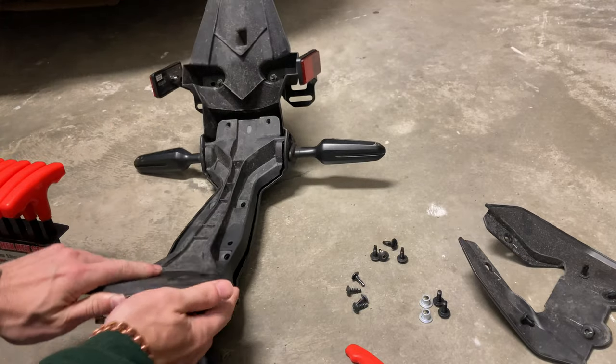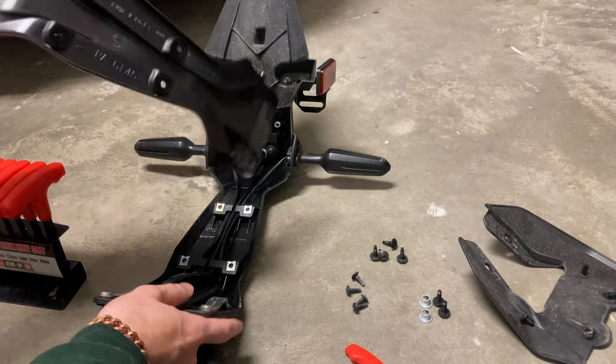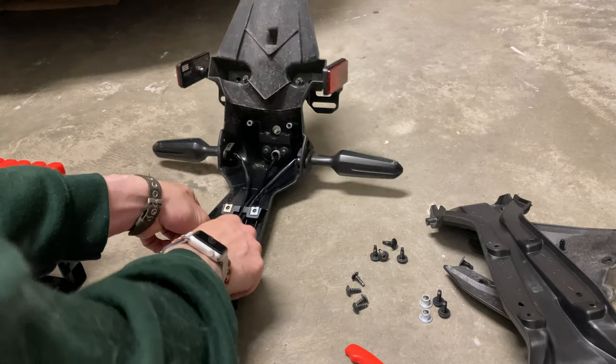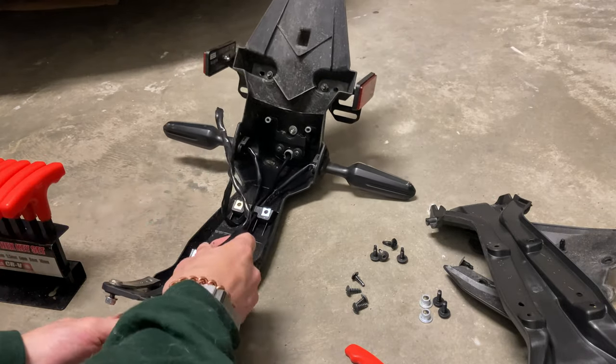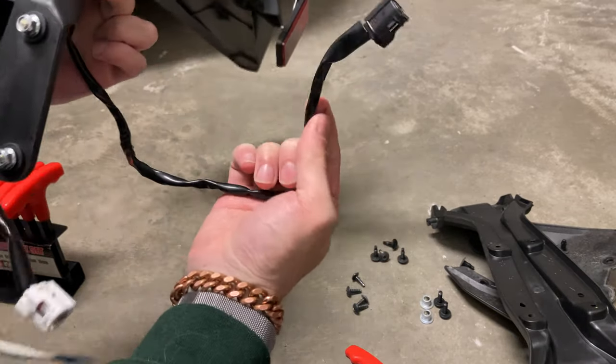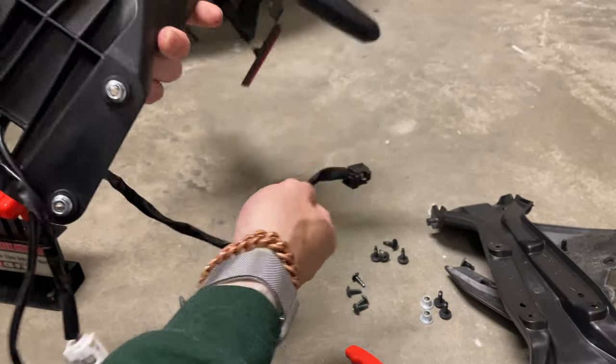You can do that and then voila — look at that, it pops right out. You're going to need to pull these wires out; they're strung between there. There's the connector — plug this black connector into the corresponding black connector under the seat.